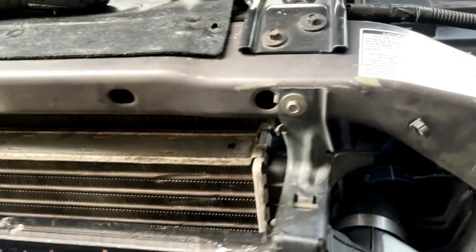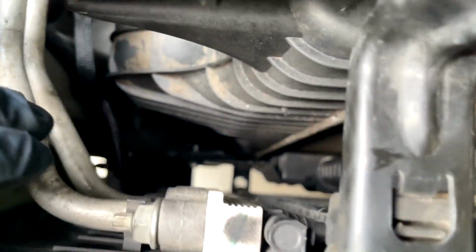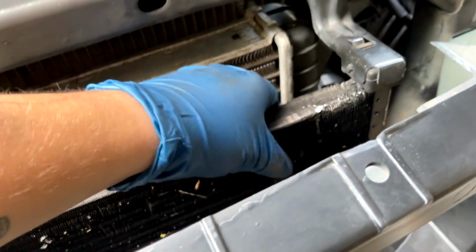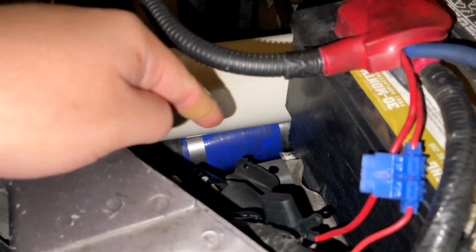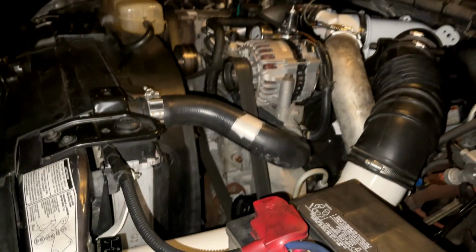And then literally it's just a bolt-in swap, and you guys can see it matches in no problem. Go ahead and put your bolts back in for your 6.0 transcooler if you did that upgrade. Put your upper brackets back on for your AC condenser. That should be nice and tight. And put your valence cover back on, and use all 8 inches of the cold side intercooler boot. You do not have to trim that one. Other than that, you guys are good to go.